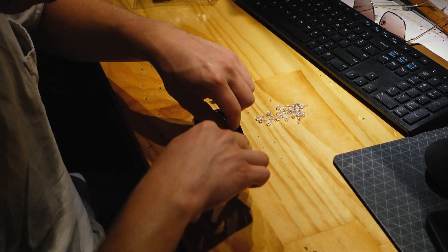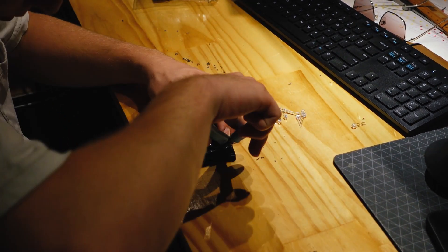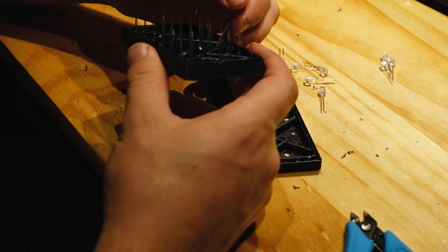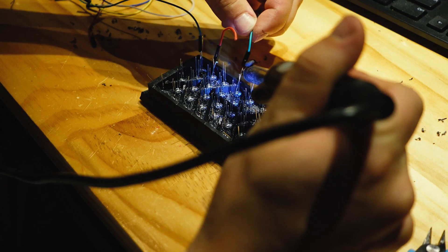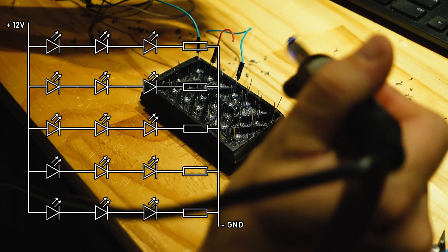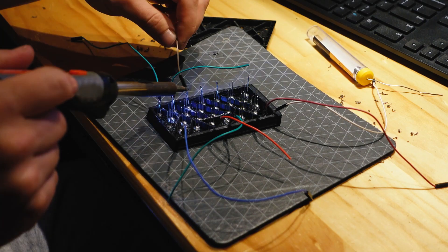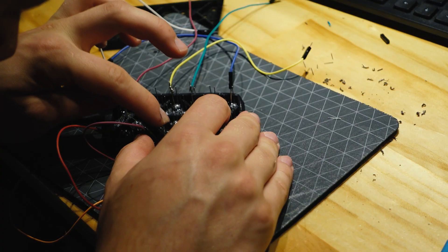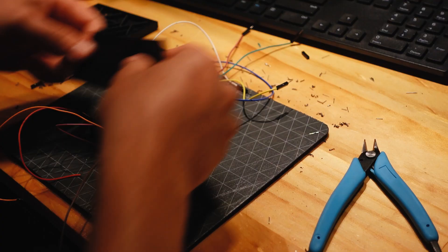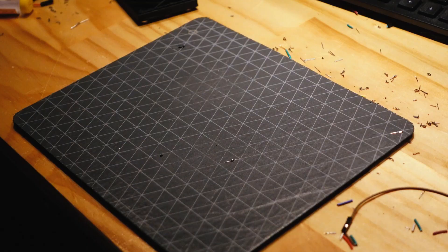About 90% of people watching this will just be watching for entertainment, so I've put the technical details in the description. But here are the basics: I'm using 4.8mm LEDs arranged in sets of 3, wired in series within each set, but all the sets are linked in parallel. Each set of 3 has its own resistor to keep the voltage at the right level — so if a module has 30 LEDs, there will be 10 resistors on the board. These join up to a common ground, meaning the whole module is powered using the existing taillight electronics with only a positive and negative cable to deal with.